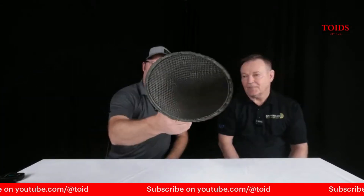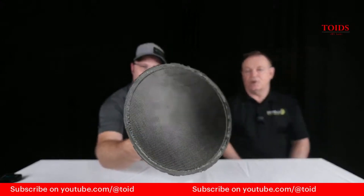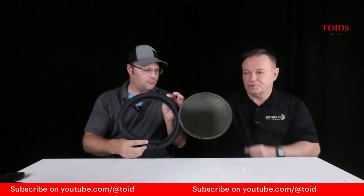If you want to pull one up — let's pull one up. So here we got the carbon fiber cone. We tore this one apart just for today to show the carbon fiber cone and the indexing on the edges where the rubber surround meets the cone. It also offers rigidity to the cone. When you just have a conical shape like this, the little fold offers rigidity.